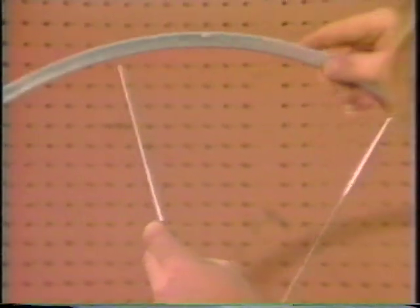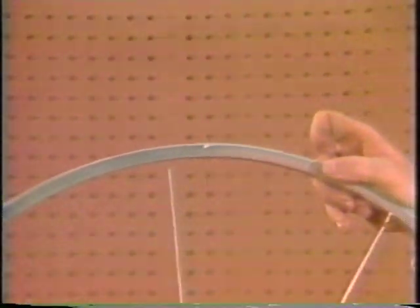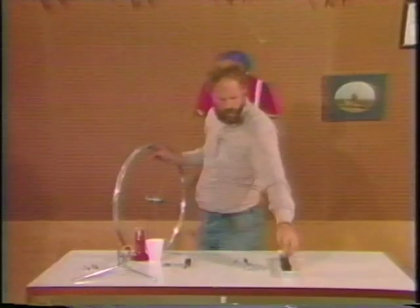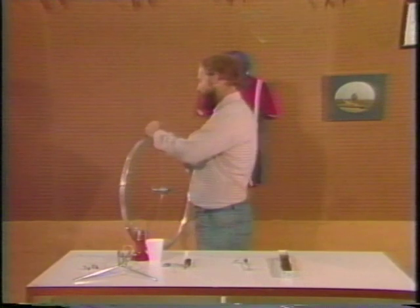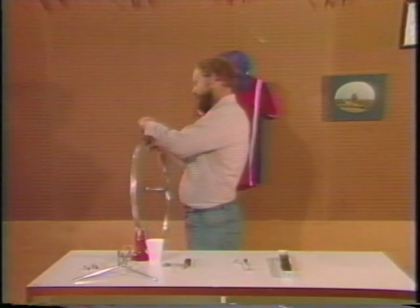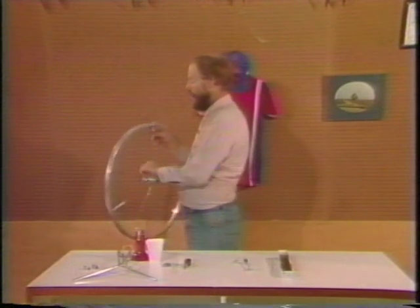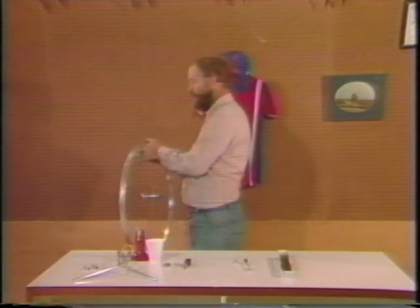Remember that you should always see 3 empty holes between each of your spokes. Just work around the flange of the hub. When you get around and insert your last spoke in the rim, you should have a pattern which is absolutely symmetric.